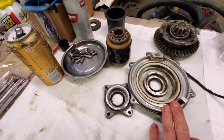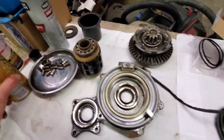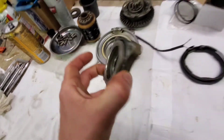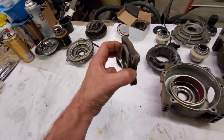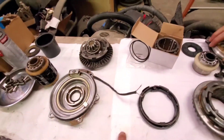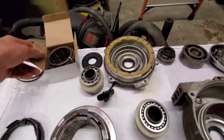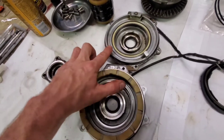What happened here: the sprag is good, it's a metal sprag. This neck piece — it broke off. There were two bolts missing and it backed out, which caused a little bit of damage to the teeth. Yeah, there's a big difference there. Here's the magnet, here's the outer case — 900 and 800.